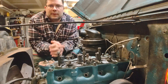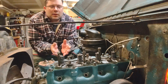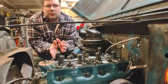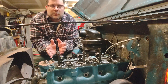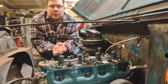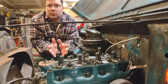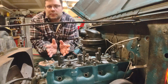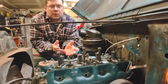There's nothing in the cylinders — we've run the bore scope down in there and can see the cylinders are clear. A couple of things we do know: number one cylinder has zero compression, which is expected. We know there's a problem with the valve seat on that cylinder; no machine shop was available during assembly so it wasn't properly ground. The guy that built it hoped it was good enough, and initially we got a little compression, but now we've got none. Cylinders two and three have 135 psi — they're great — and number four has 120 psi, so we've got fairly good compression on all but one cylinder.